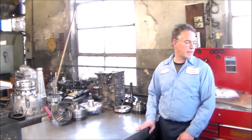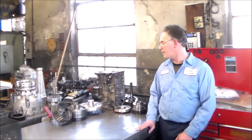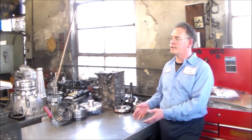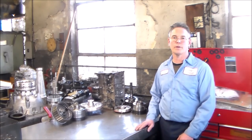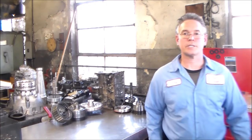This one has the accumulators here, and also has two accumulators in the case, and it's marked. This is RV, which is probably reverse brake, and DC, which is direct clutch — for the accumulators. So we will continue tomorrow morning, do a highlight video — go through everything, and then I've got to put it aside and wait for my parts.